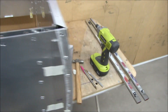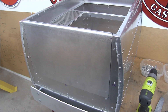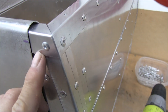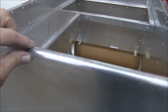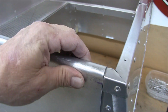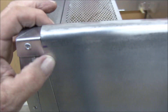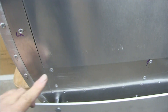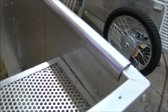I had to take off the rails but that was easy. I think I have this fitting the way I want — I trimmed back the corners right here so that it will lay in nice. I also hammer-formed this over that steel rod and got it to fit really nicely. I trimmed it back right here, so I need to trim the length. I might hem that over and make it look like a hinge line, but I'm happy with the way the top rolled.